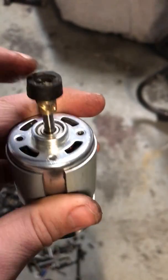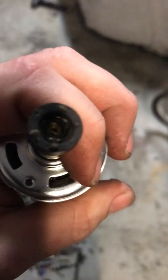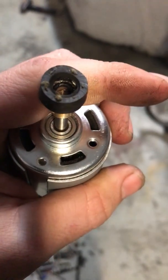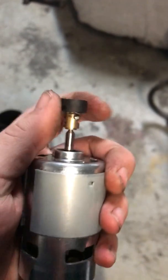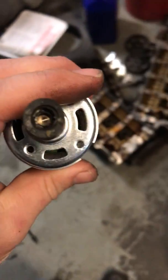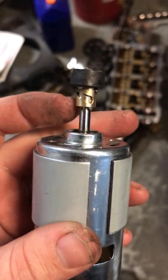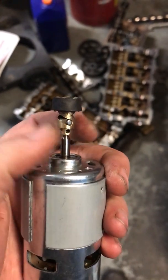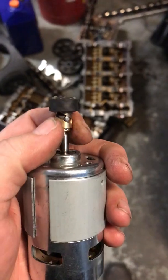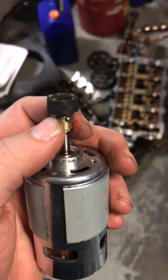If you look down here, I ended up having to add this rubber grommet onto the end, as there's a small rubber grommet on the inside that was not large enough to engage the compressor housing. It ended up riding on the outside brass sleeve of the Bendix clutch and didn't engage the compressor wheel nut enough to get it moving.